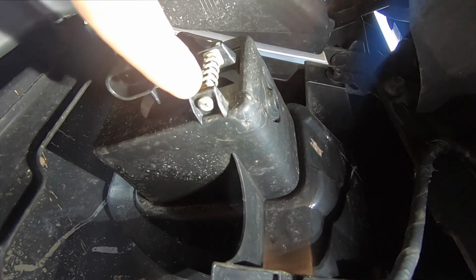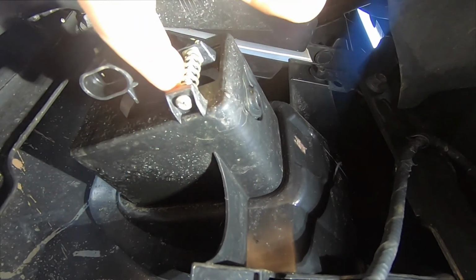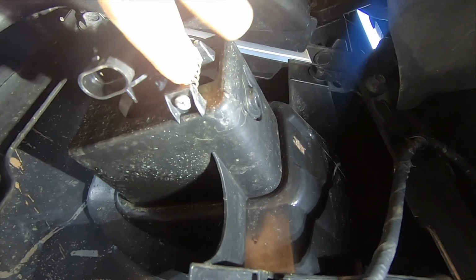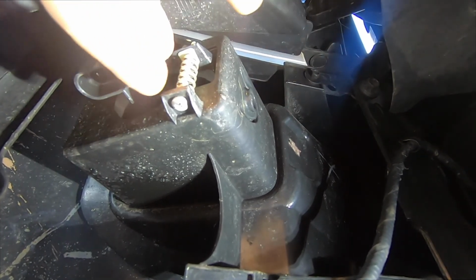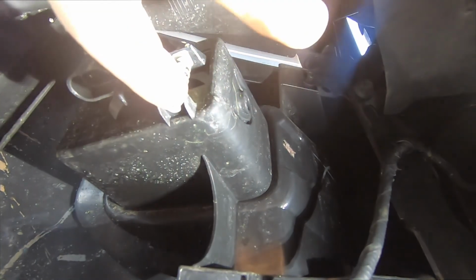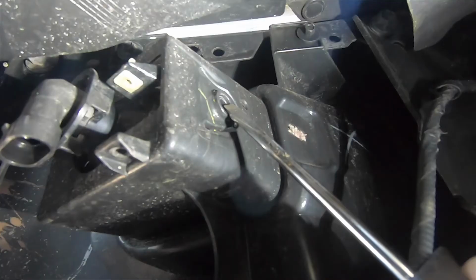My screw was 2 full rotations of the screwdriver, and then the spring is loose, like that. So now you know when you put it back in, you get it a little bit snug like this, do 2 more full rotations and it'll be back to where it was. Or like I said, you could just level it yourself. So then we take this entire screw and spring out.